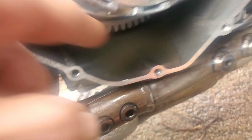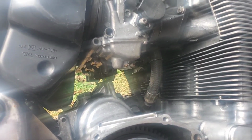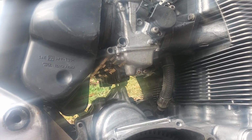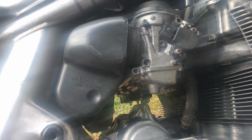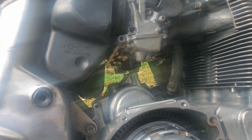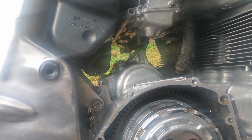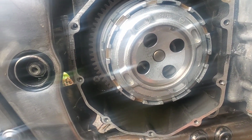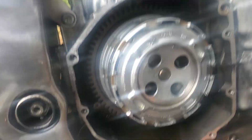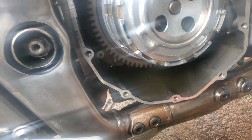because that's gasoline, which means one of my float bowl floats is sticking open, and the petcock is not closing when it doesn't have a vacuum on it, and it just allows it to free flow fuel into the crankcase, which is lovely, but that doesn't change my current agenda.